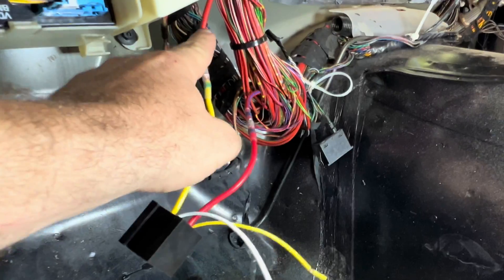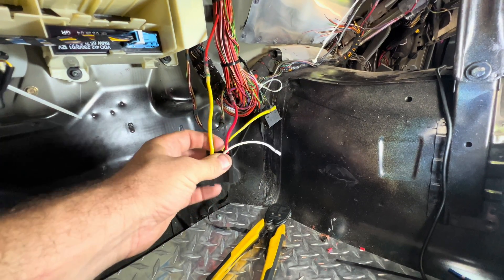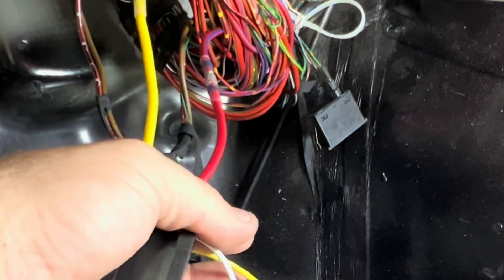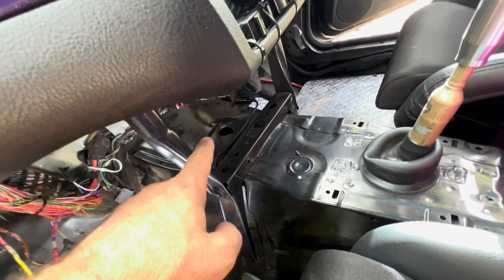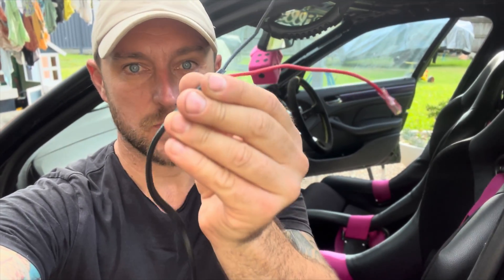We've got the wiring for the fan hooked up to the power side of the relay. Relays have a lot of numbers on them — number 30 is usually your power in and 87 is your power out. We're going to run these back over here to get our power out of the back of the switch, and earth the relay to one of our junctions. I've got some two-core wire for the switching wire for the relay — one plug on one end for output from the switch, and the other tab goes on the earth junction from earlier.